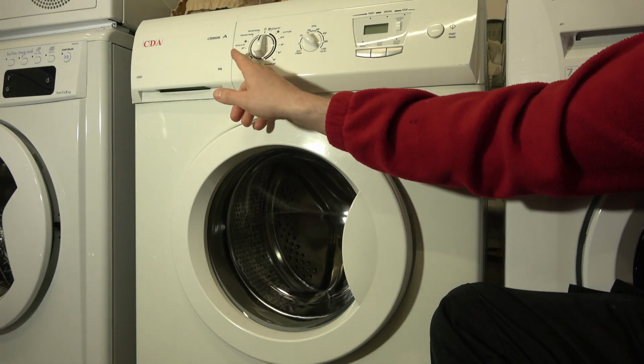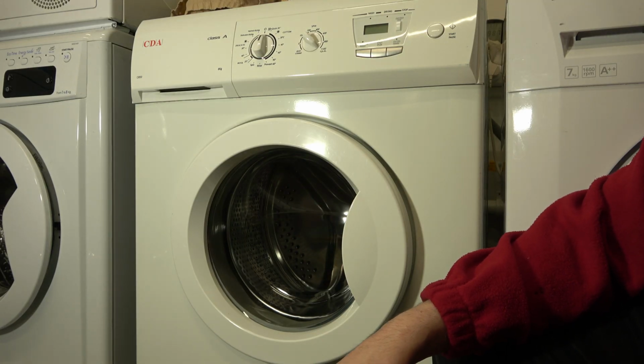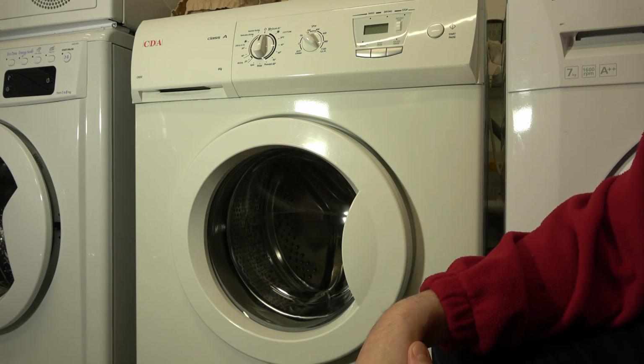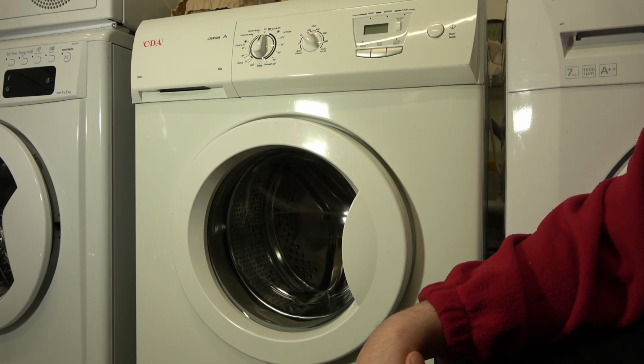I think the wool took half an hour before it aborted the final spin, trying to balance the jumper that was in it at the time. But even on a normal cotton cycle, with just old towels, let's say, that's fully loaded, it was still struggling to balance the load and even would limit the final spin. That's annoying. And it gave poor rinse results in the end because of it.